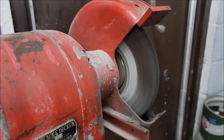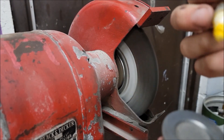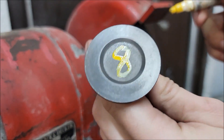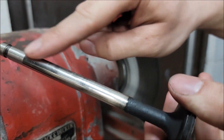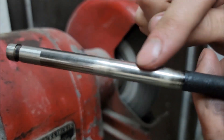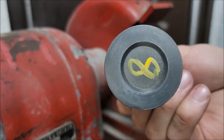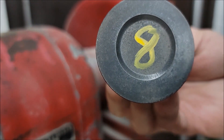This is the number 8 exhaust, so I'm going to mark that accordingly. The reason you want to mark them is in case you do reuse your valve train — your guides are mated with the valves. Some people will polish out the stem. Do not do that. That's a terrible idea from a machinist's view. All you're doing is removing material. This is good practice — the valves seem in good shape, so maybe they'll get thrown into another build.